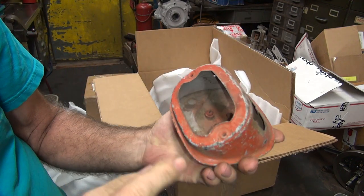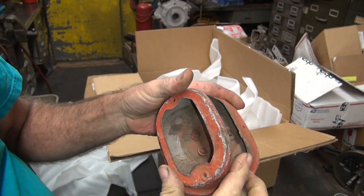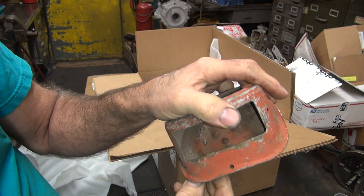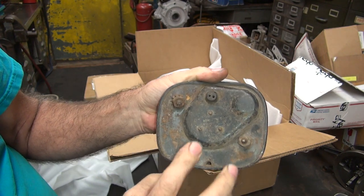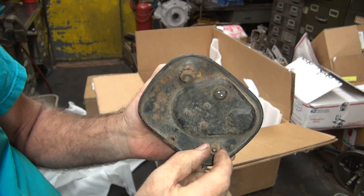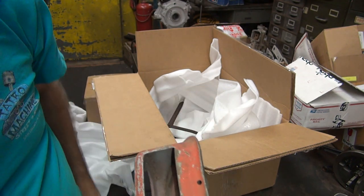Here's a late tail light. This one is a '55 as I recall — up inside here they have a date, so it'll be something like dash-55 or dash-68, and the guts inside are different between those years. It's got the factory nuts on there. The stud is supposed to be riveted and swedged in, but this one's loose — both of them are. It looks straight though, and the screws look good, so it's not too bad a condition. These studs need to be soldered so they stay put.